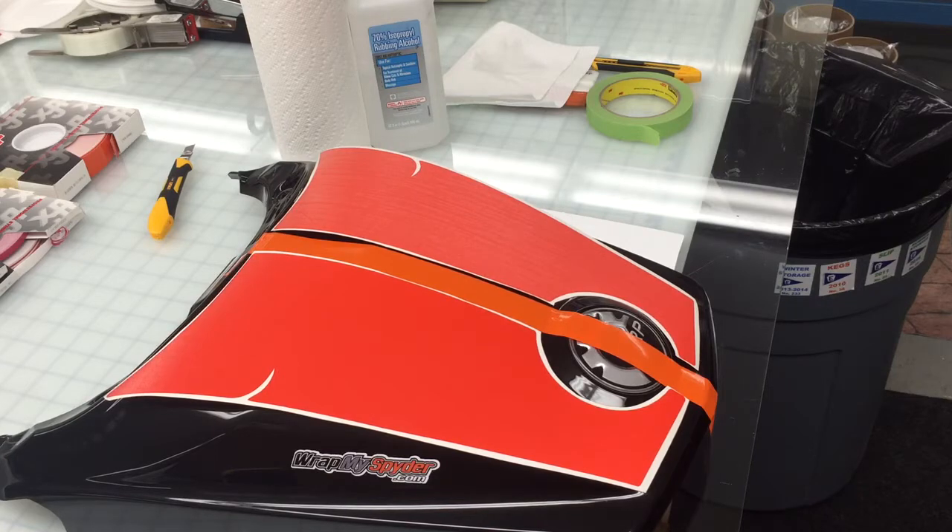When you get your kit, it's going to come in two pieces: left side and right side. Currently we have them just dry set on the panel. We've already installed our one inch gap tape, as you can see, that runs from front to back right over top of the BRP emblem, and that's going to even out the stripes to help you with placement and act as a guide for your installation. Up to this point, you would have already prepped your surface with 70% rubbing alcohol and kitchen paper towel, and you're going to be using the supplied squeegee that we give you, and you'll need some masking tape and scissors and/or an X-Acto knife.